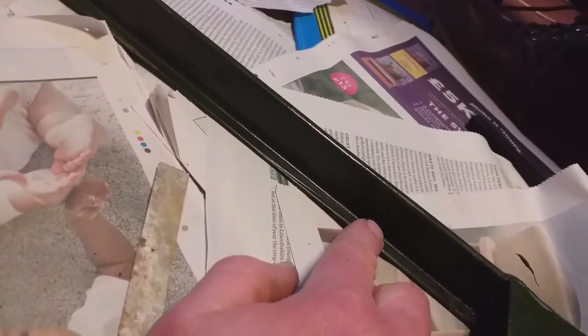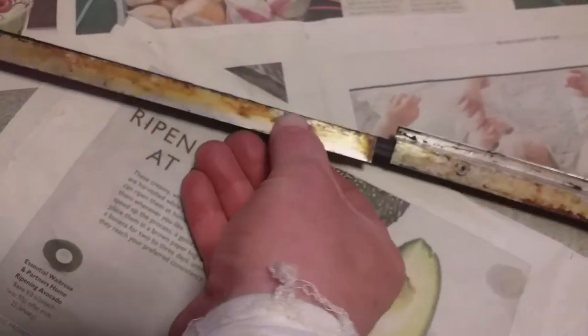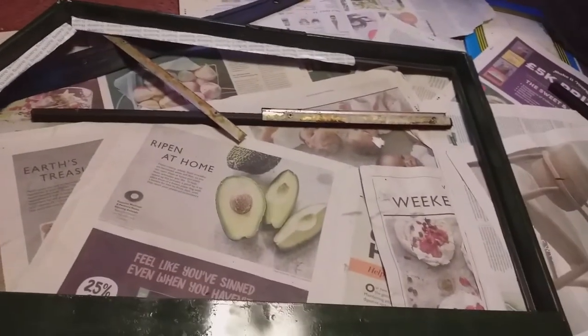The side piece can go on and we can leave that on. What I've done here is attach the fixed glass stop to the underside of the new channel before it goes in. When you put a stop on this you have to have a shim on the other side to make up for the difference. All of that will bolt to the top of the door top when the fixed glass is in place, the bottom runner is in place, and the side channel is in place — then this will be the last piece of the jigsaw, just slotting on the top, and we'll screw that in by jiggling the glass backwards and forwards.